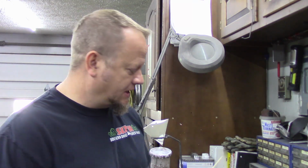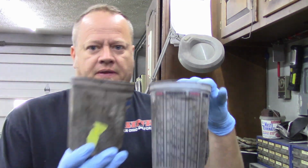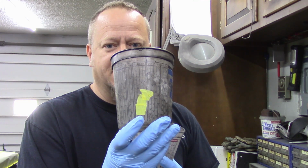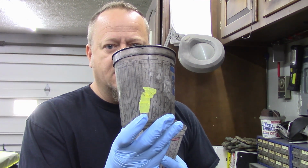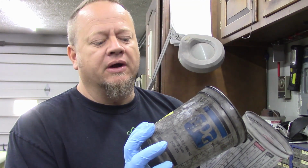So as always, we're going to be spraying the PPG CRE epoxy thinned down according to the tech sheet to be able to use that material as a sealer. But when I'm over here, I've got everything set up. I've got my stir stick ready to go. I have 2 paint cups that I keep handy. One is going to be marked out with my mix ratio all ready to go so that when I'm pouring, I can see it and it's not an issue.